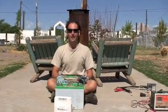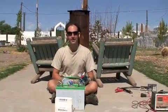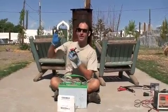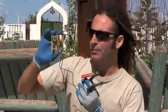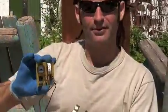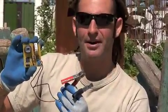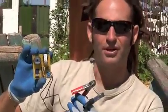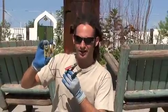Hi, I'm Mikey Sklar of Holy Scrap Hot Springs, and today I want to share with you how to desulfate a battery. This device right here is MiniD, a battery desulfater. What MiniD does is it generates high voltage pulses based on the battery's own energy and puts it right back into the battery. If a battery is stored below 12.3 volts, it will start to sulfate. These 12-volt batteries can be restored with the battery desulfater.